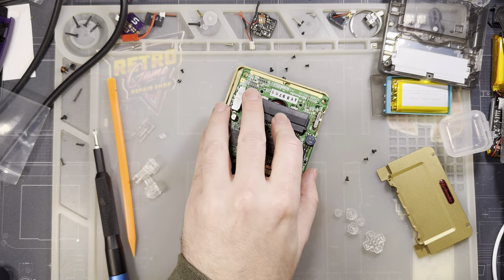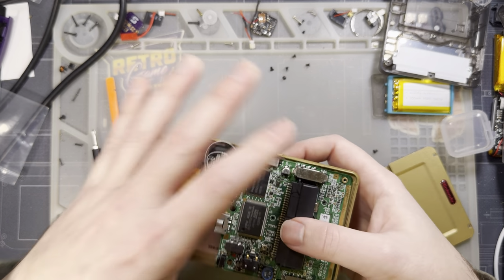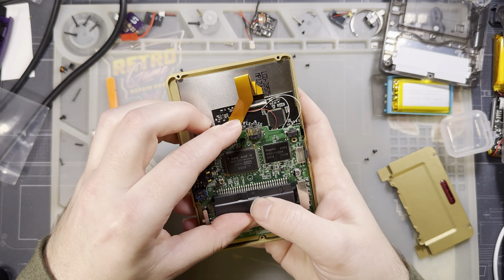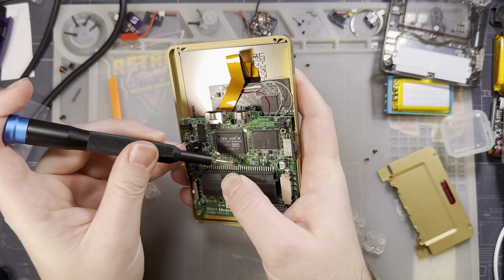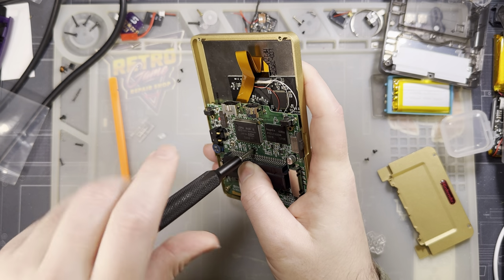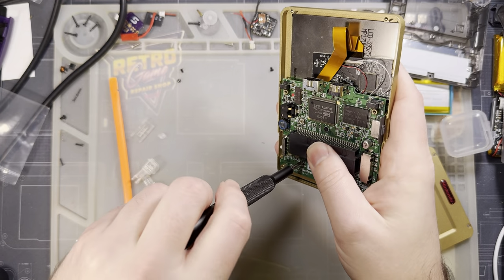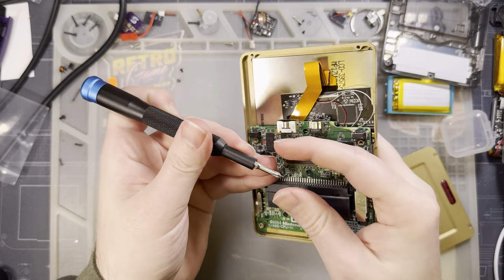Anyway, I started talking about this, but I think I got distracted. If you're doing a whole bunch of mods to your console, do one at a time and test it between each one. That way, if something goes wrong, you have a starting point on where to troubleshoot. Though in this particular case, I don't really count swapping those buttons out as a mod, so...